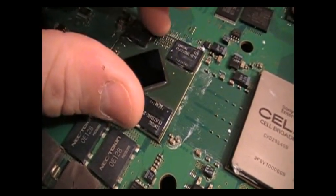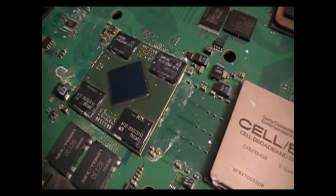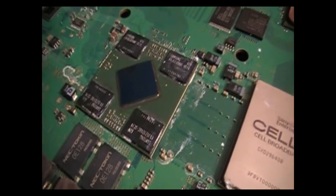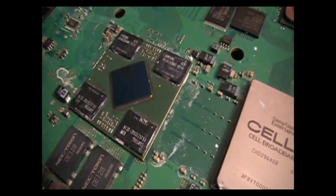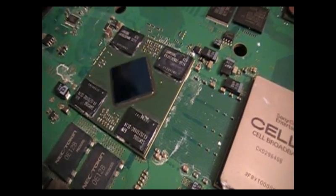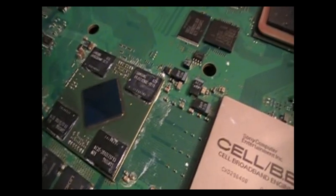He had a way to prove it. He said to actually heat the chip to like 115 or 140 degrees and it would magically work. Now this is under the temperature of what solder melts. So if that's fixing the chip and it turns on again, how could the solder balls be the issue? I have tried this technique on many PlayStation 3s and he is 100% correct.